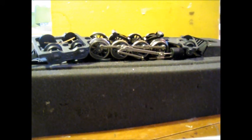You want to get a drop very sparingly right between the pickup roller and the frame. And if you get any on the roller, you gotta remove it. I generally just use a paper towel, or maybe just a damp paper towel with some isopropyl alcohol, to make sure I just clean it up really good. So that's basically the lubrication. There's not much here to lubricate.